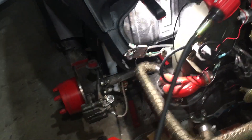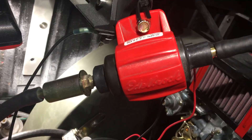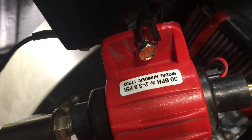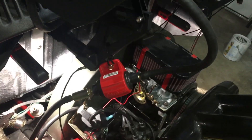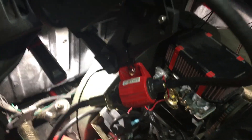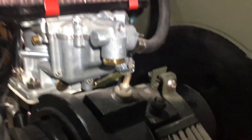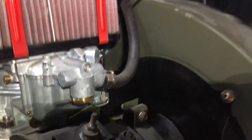You're going to need a fuel pump — obviously put a filter on it to filter out the garbage out of today's gasoline. This is a self-priming Edelbrock fuel pump. You're going to need two to three and a half PSI; most carburetors like around three PSI. I'm going to put a gauge on it to see what it's running, and I may put a regulator on it, but if it's running between two and three I might not need one. You'll also need power to your choke.